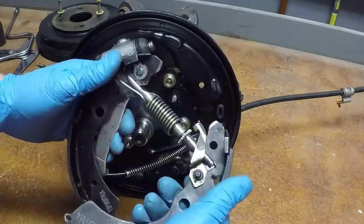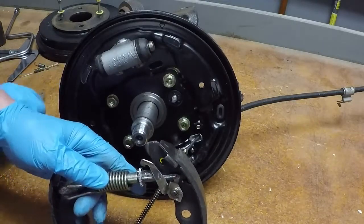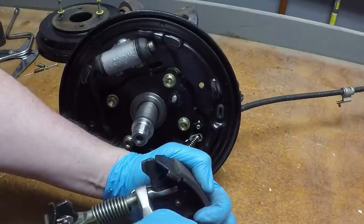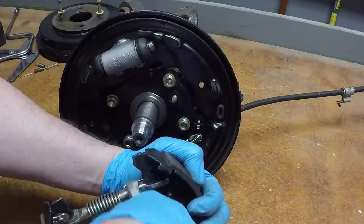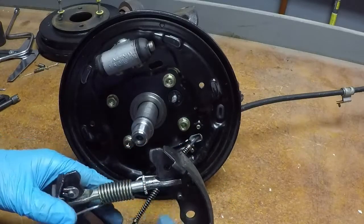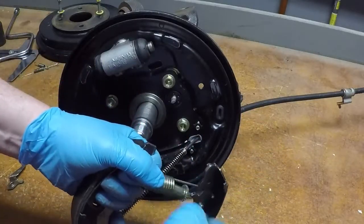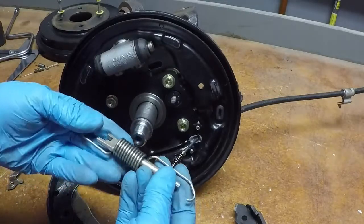Here's our adjuster. Notice this isn't turned all the way in, so I'm going to grab it and turn that in. We want to make the rod as short as possible, because the shorter the rod is, the easier it is to get the spring on. See how that's nice and short now — it's bottomed all the way out. Now it's a simple matter to separate the spring out, and there's our spring on our adjuster.